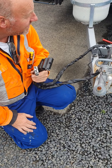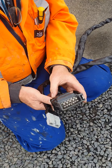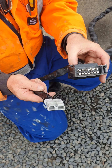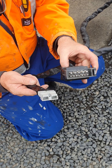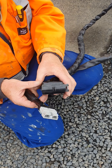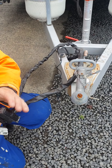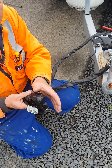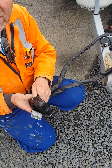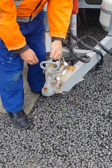When you get this van home, you're going to need to have your car wired for a 12-pin plug and for an Anderson plug. The reason being is they run auxiliary components in the caravan, and it's also got electric brakes on this one. You need the electric brakes because it's got a handbrake but no other brakes that are electric. Get an auto electrician to check the wiring and match it up before you go anywhere.